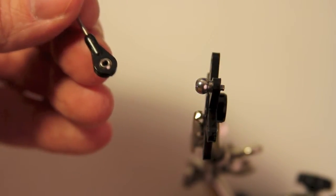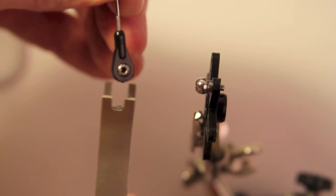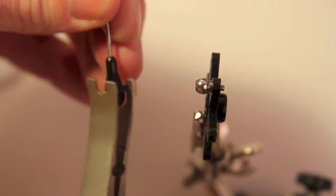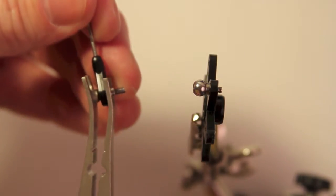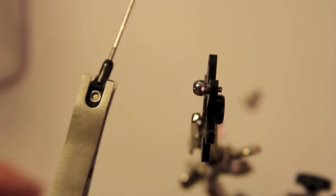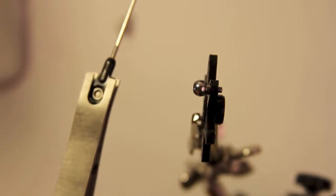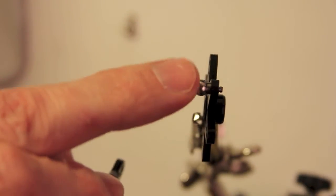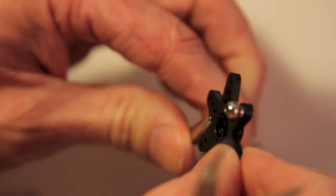To remove it, you basically flip it over so the wide horseshoe is around the ball, and that little nib is on top of the ball. What that's going to allow to happen is this horseshoe, flip it over so you can see it from underneath, this horseshoe basically is going to push down, and it just forces that ball right out of the plastic, and that nib is what kind of helps make that happen. So I have here a ball on a star-shaped servo horn in a helping hand.